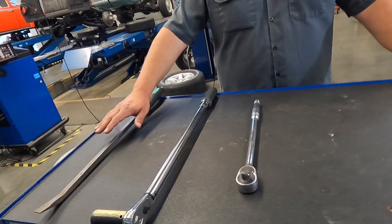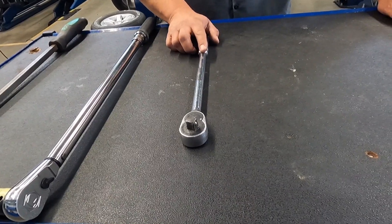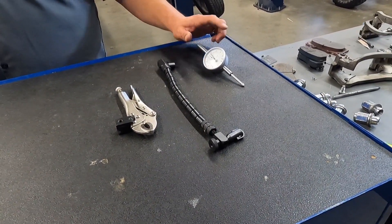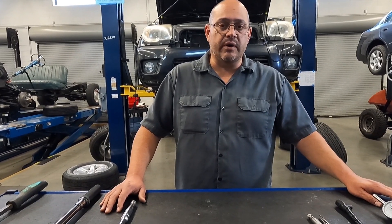We just went over how to check brake rotor runout. We'll compare the measurement to the specifications and then determine if we're going to machine or replace the rotor, or put it back into service as is. Just one more time — the tools I used from left to right: a pry bar to hold the rotor from spinning, a 21 millimeter socket and torque wrench, a half inch ratchet, the locking pliers, the snake slash dial indicator holder, and the dial indicator itself. Thanks for tuning in — please follow, like, and subscribe to Omar Sevilla on YouTube. I look forward to your comments and hearing from you guys. Have a good day, thanks!